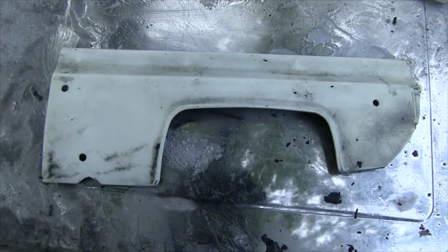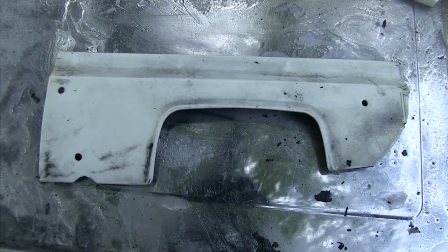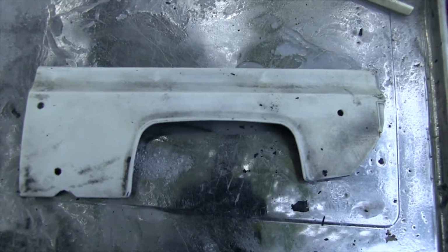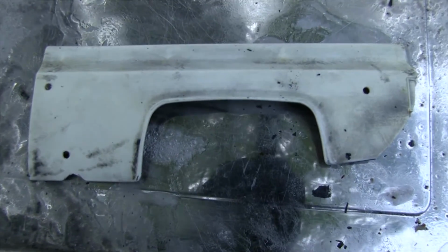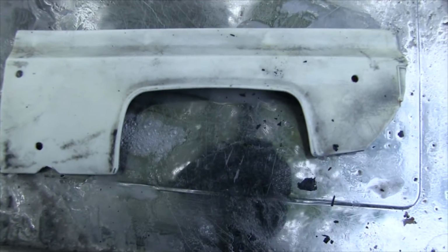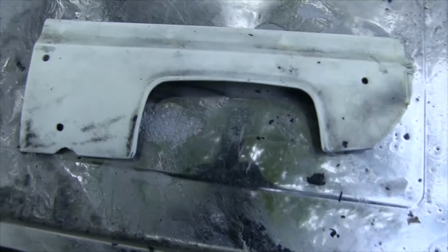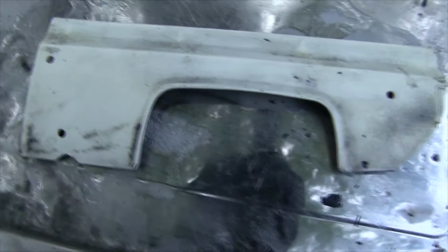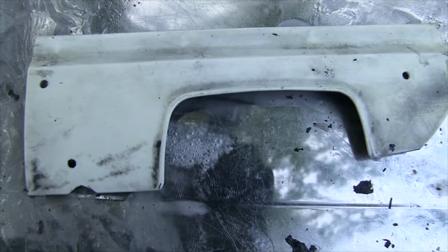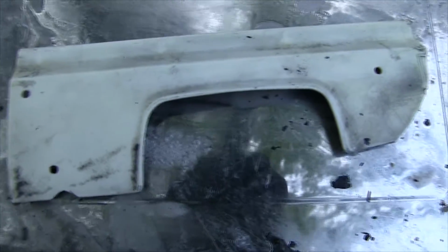I will say that I have used other chemicals to try to do this. I've done the brake fluid method. Took forever and didn't always work. I've tried it with Lexan. Didn't work for me with Lexan either. Easy Off and Lexan, it will work, but it makes the Lexan brittle, so don't mess with it. I've got a tutorial video that I put up using nitro fuel with paint removal on Lexan, and that worked just fine.